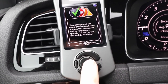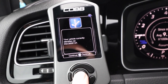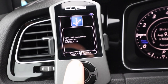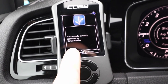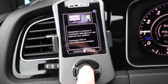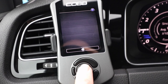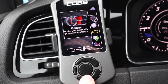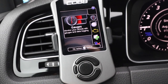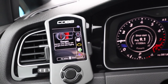Now I hit OK and it's going to detect if it can flash the transmission. It shows my vehicle has a transmission with supported software, which I already knew because I checked with OBD11 first — so I downloaded the files supported by that software code. Now it says I can connect for new updates. And now I have access to live gauges and lots of extra information, which we'll get into in another video, because this one was quite long just getting it working.